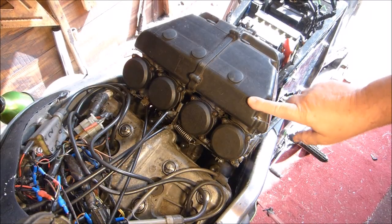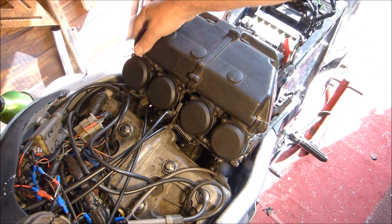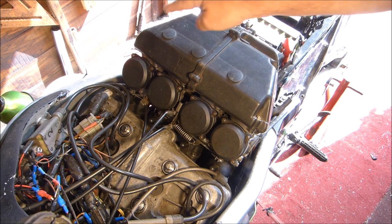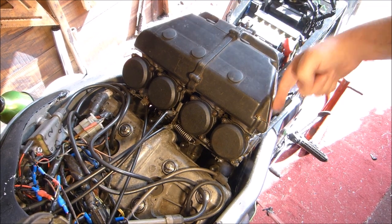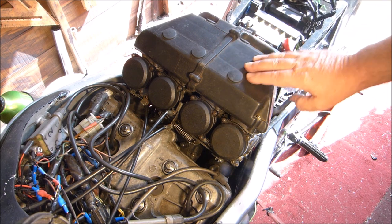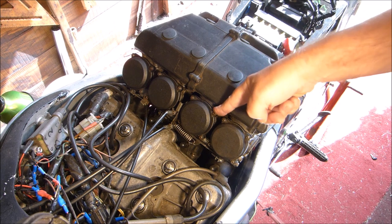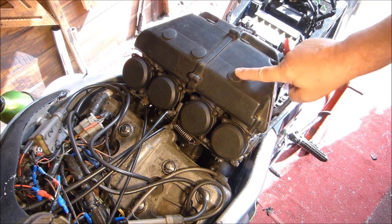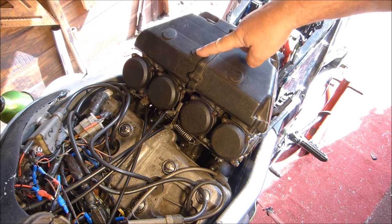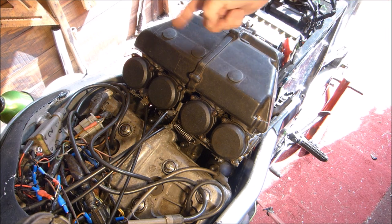And on my carburettors, there's the air filters where there's a bolt there, a bolt down here, and all these little grommets. There's bolts inside those as well. So it is very awkward, because you have to fish all the way down. There's a big tunnel all the way down to the carburettor. So you have to fish with your spanners or whatever. I think mine are Allen keys. So I have to fish all the way down there to reach the screws.